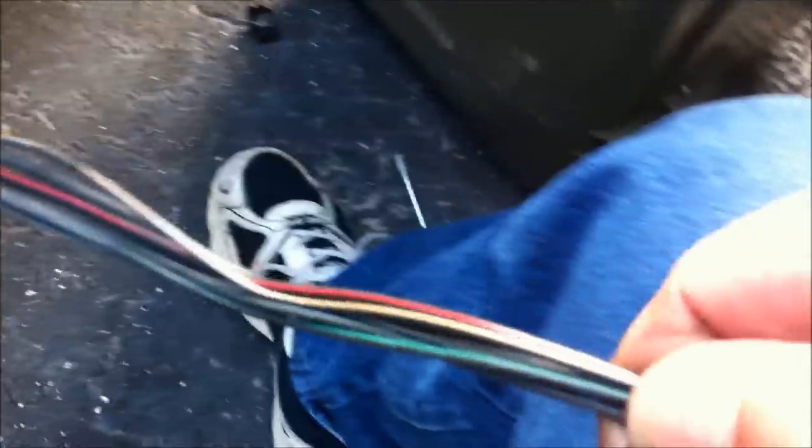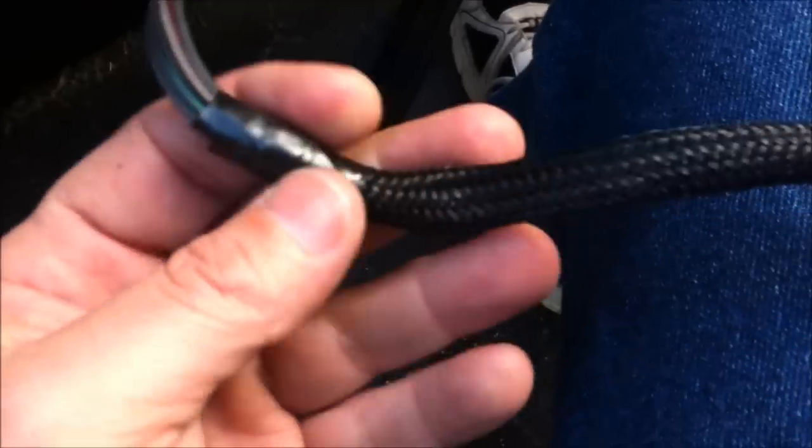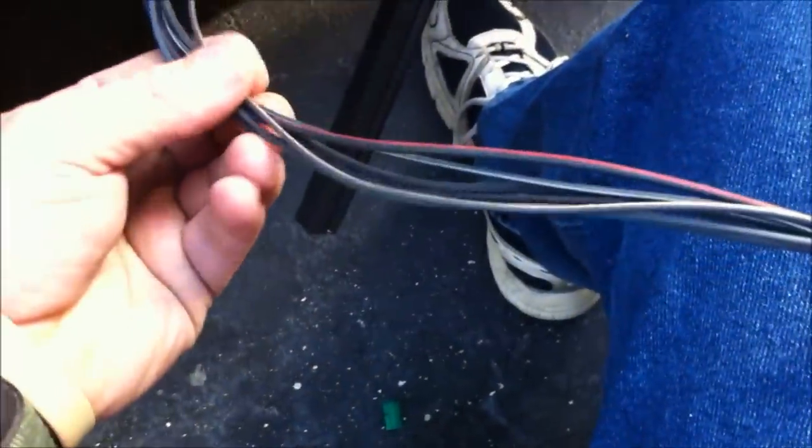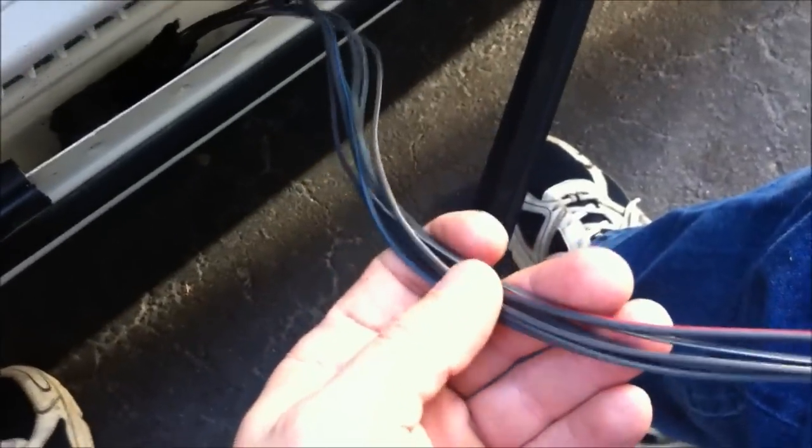Make sure the replacement wire is the same diameter or larger. The other splice point will be underneath this wire loom right here — pull it back and do it on the inside, which makes it easier. When you do the splice, do one of them inside the wire loom since that's not a flex point, so you don't need to worry about it as much. Make sure the splice doesn't go too far into the wire loom. When done, put a little piece of tape around here. I try to put a small piece of tape around the wires every so often since I don't like all the wires flexing freely.